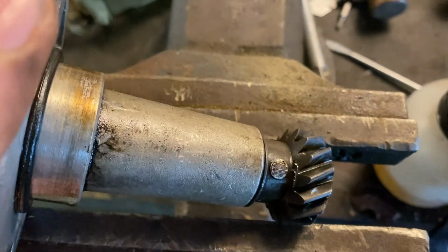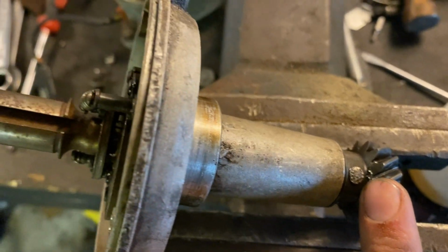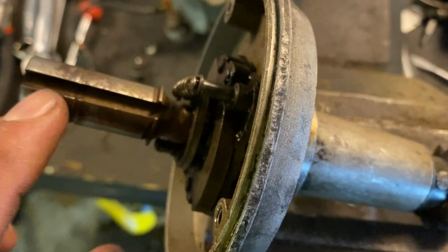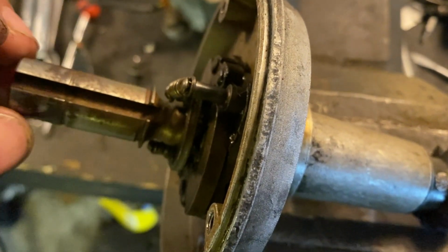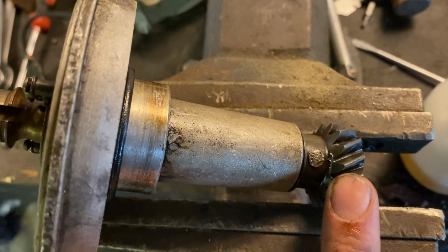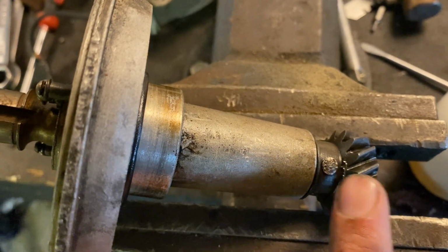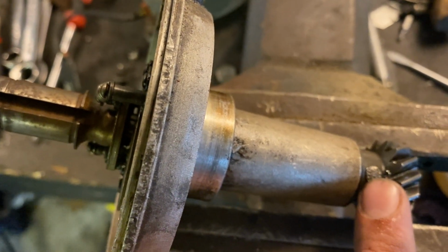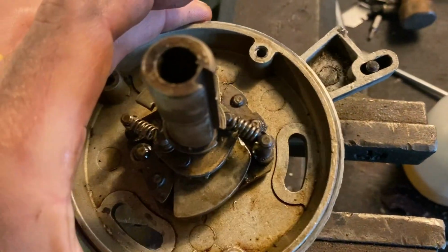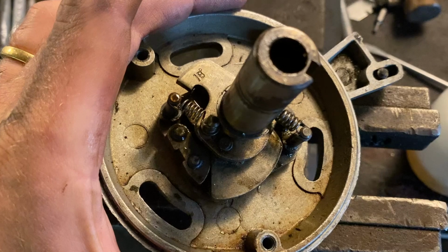So here you have the distributor gear, and there's a rivet there, and that rivet lines up with this here where the other parts go on, and then you have the rotor up here, and that's the same on all spare distributors I have. So if that rivet would have sheared and the gear would have spun, it would definitely not line up perfectly as it does. So I'm going to put this back together, and then I have one thing I want to check down on the car when we're ready to put the distributor back in.